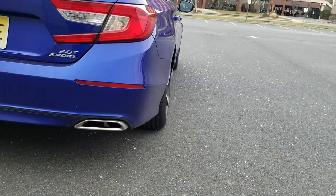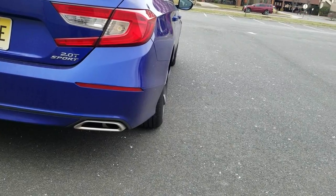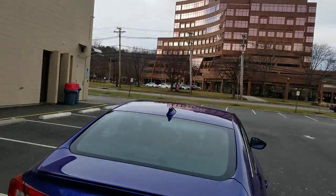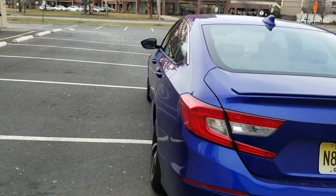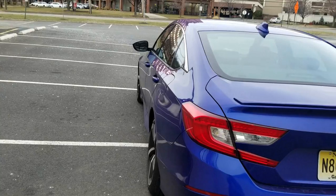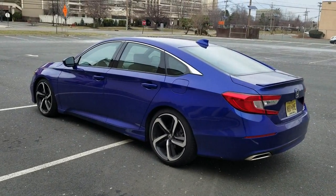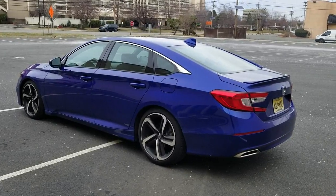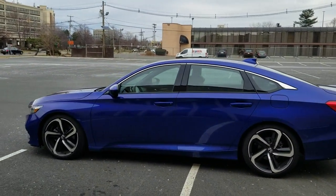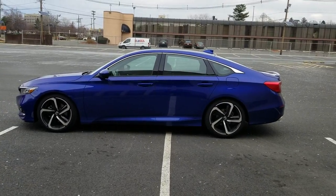One of the reasons I ended up getting the camber kit is because the drop created some negative camber. If you look at the rear, on a negative camber setup you're reducing contact patch — it creates uneven pressure distribution and you get less grip. I know a lot of guys like that negative camber look, but I personally don't. Check out that left wheel — you can see the negative camber. That's going to be fixed with an alignment, which I haven't done yet. I'm going to do it in about a week — the guys said let the springs settle first. I'll give it a few days and then do an alignment. As you can see, it looks like a stock drop, like it came from the factory — that's really the look I'm going for.